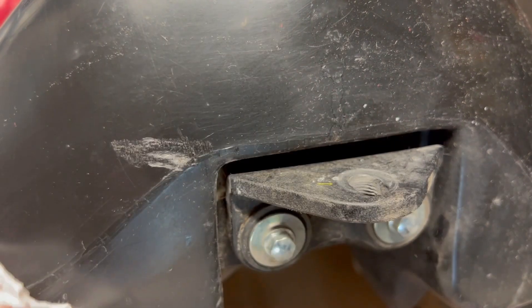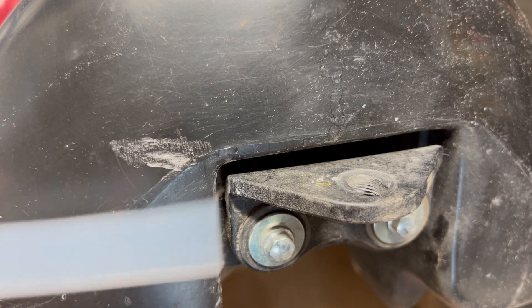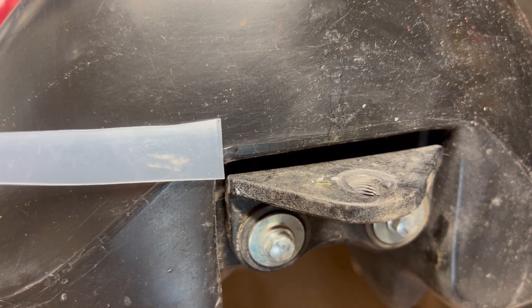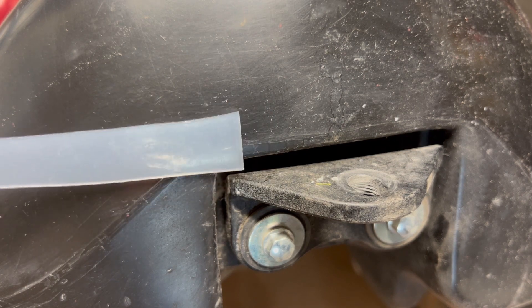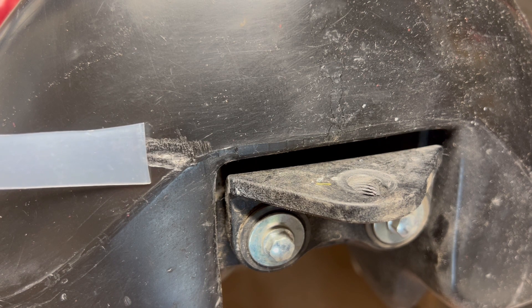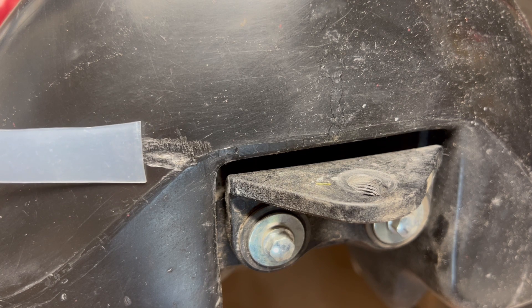Okay, I'll let that dry out a little bit. That looks pretty good. We'll get the heat gun going with the LDPE plastic. This is just some strips I cut from a condiment bottle — a little flip-top lid. On the recycling symbol, this is the number four. Make sure you use the number four recycle, which is the low-density polyethylene. There's a lot of science behind it that I don't quite understand, but from what I've read, this should work out just fine.